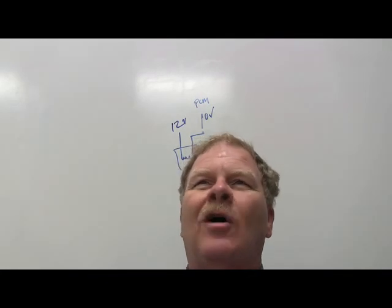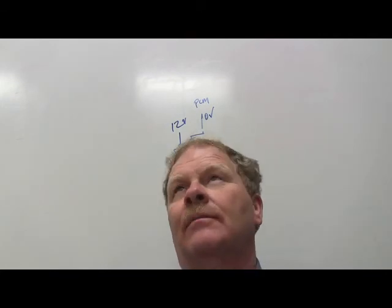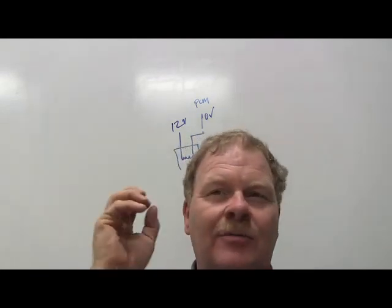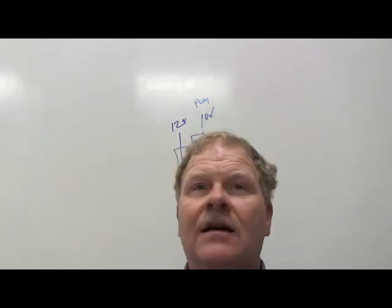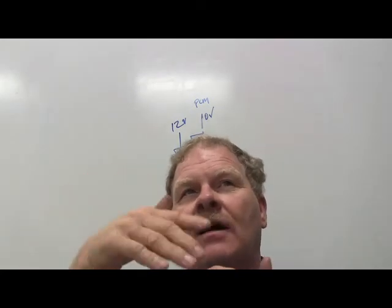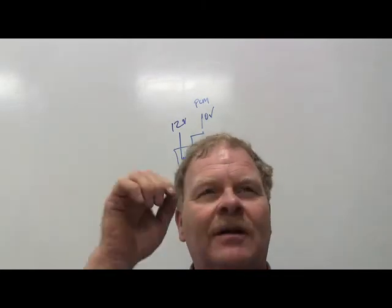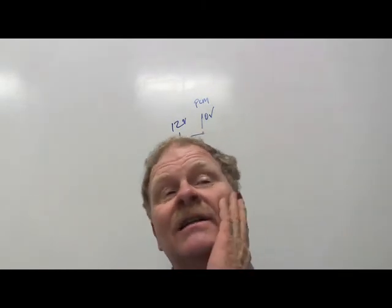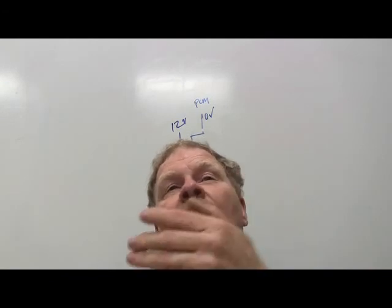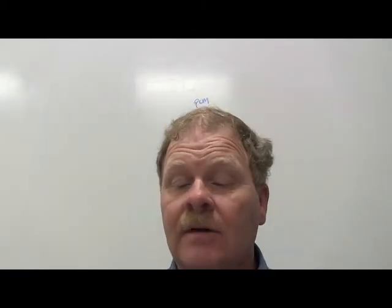Now, if you've got a crack in the exhaust that's up there close to the sensor, remember how I told you the exhaust system has pulses? It's not smooth, even though it feels like it. If you actually could measure it, it's got pulses. Because it pulses, if you've got a crack that's configured the right way, it'll let some air pulse into that exhaust stream, and it'll go down there and confuse your oxygen sensor that way too. So basically what you're wanting to know is, what do I have letting air in that's going to cause that?